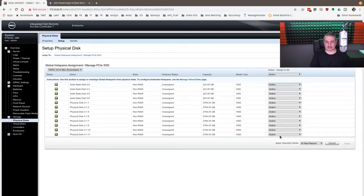It does have convert to RAID, but I don't think it let me unconvert them, which is why I had to go into BIOS. If you have more than one controller, you'll be able to navigate those here as well. Also, if you're using RAID mode and letting the PERC controller handle the RAID, you can configure hot spares — that'll allow you to have a spare drive on the ready to drop in if there's a RAID failure, making management easier. If you want to let the whole system handle it all for you, that's absolutely possible.